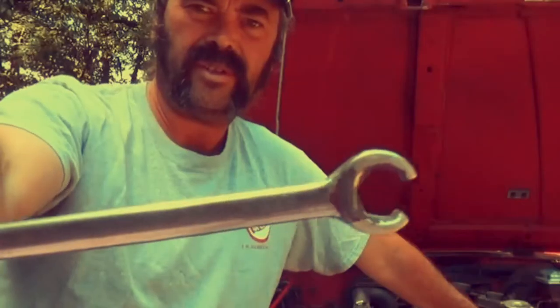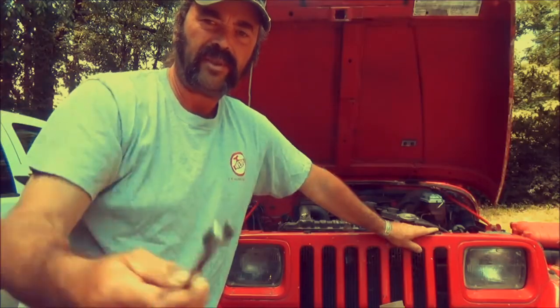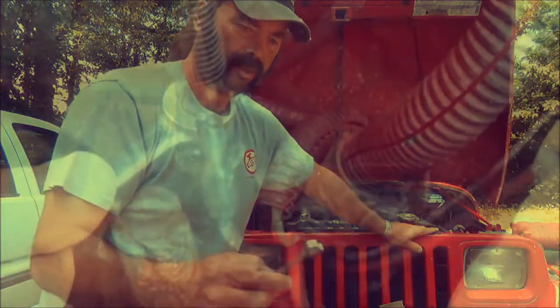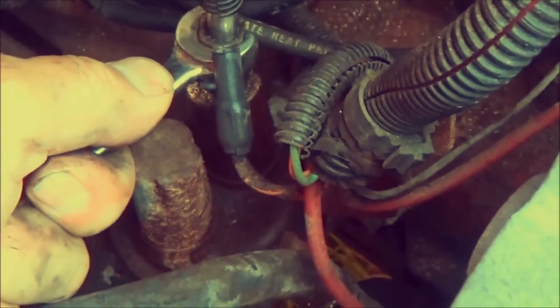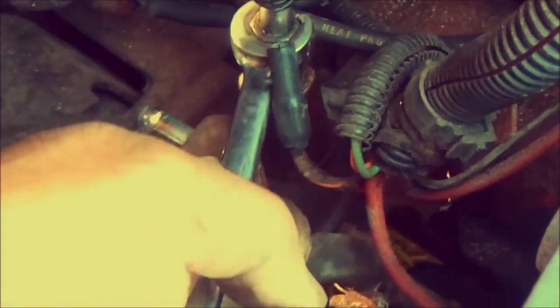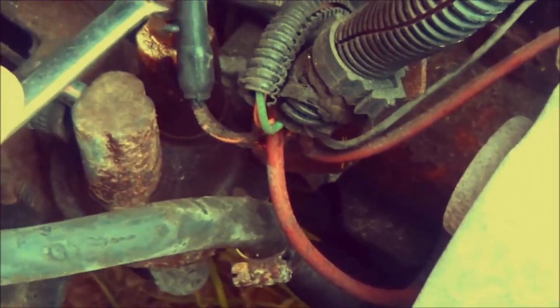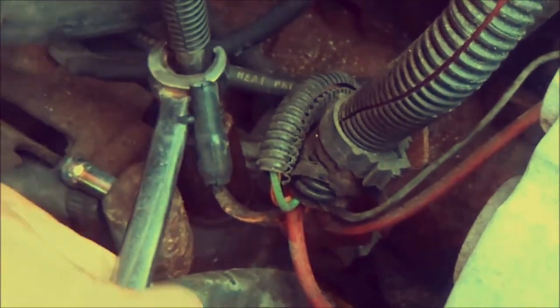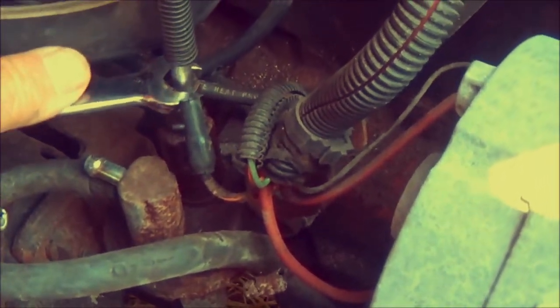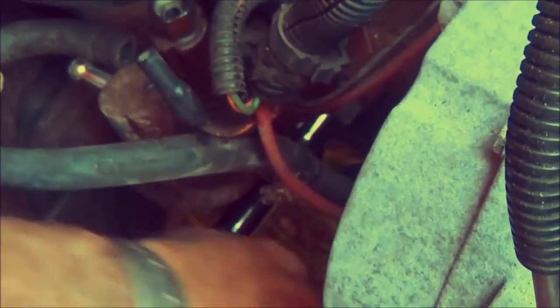Good example of a flare wrench — what you'd use a flare wrench for. If I put my half-inch wrench over that nut holding the fuel line, it wants to spin and round it off, but a flare wrench gives it enough grip. Yes, that is tight. I got it. That was a lot easier than I thought it was going to be. Those come out nice and easy.